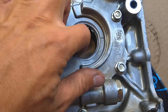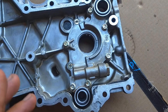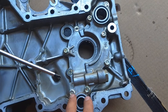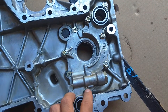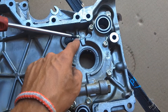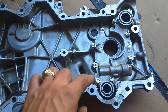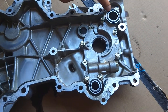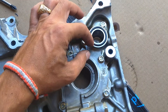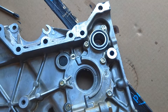In order to remove and replace it, it's super simple. All you have to do is remove these bolts — you can see with a 10 millimeter socket, there are seven bolts total, and you have to get those loose. Those can be a little bit tricky sometimes — you can hammer them just a little bit with a screwdriver and they will come loose. Now, every time you replace the pump, get new seals and new oil rings as well, because if one of those is bad, you lose oil pressure and you might need a new engine after that if you don't catch it on time.